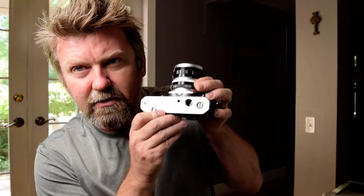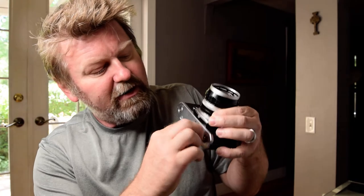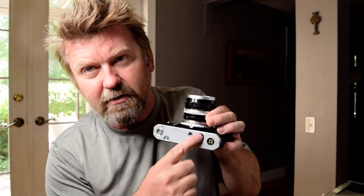Some of the things you should check if you're looking at an old Nikon lens and camera. First of all, the problem with the camera was these use a battery — either a single 3-point-something volt battery or two 1.55 volt batteries that tuck in there. Now there's a little tab — there's a little tab down there. Sometimes you just got to get a fingernail under that, lift it up a little bit to make better contact and clean around the contact at the top. That's all it takes quite often. That's all it took with this camera.